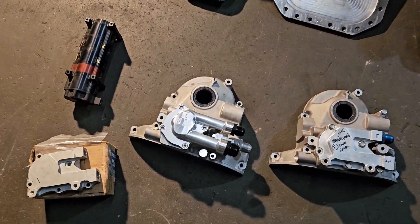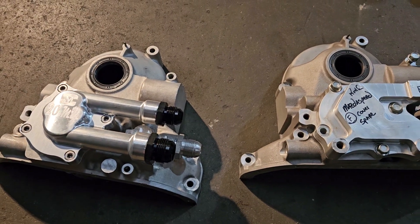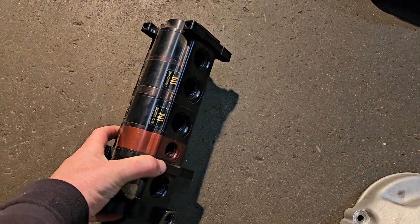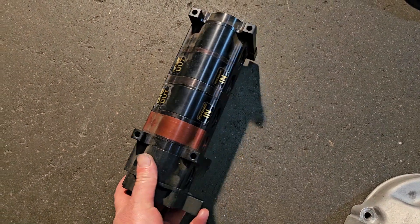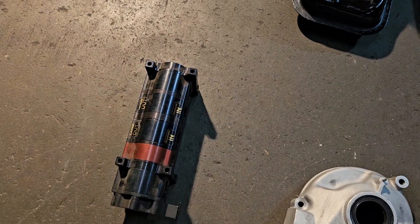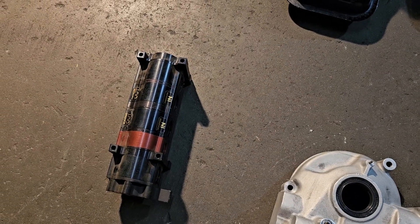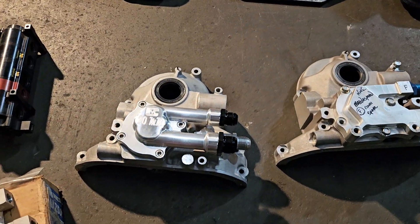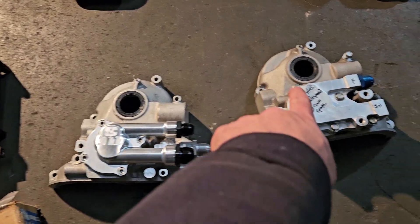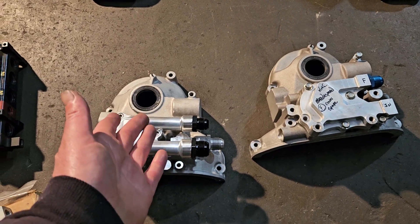So that's the brap — talking rotary parts. You've got factory dry sumps, gear driven, running a flat plate, making your rotary sit really low in the engine bay. That's how all the factory race cars were done back in the day. Or if you can't get that, a lot of drag racers, street cars, and performance cars can definitely utilize an aftermarket setup where you're just stacking dry sump pumps — as many stages as you need, whether it be three, four, five, or six stage. That's basically what I'm running in my drift car right now on a three rotor, and I've had pretty good success with it.